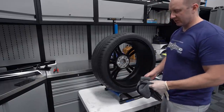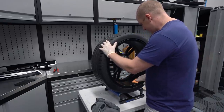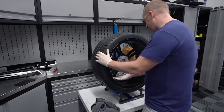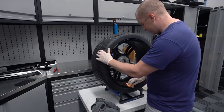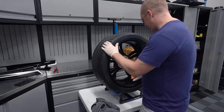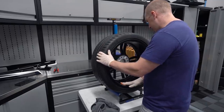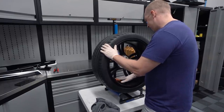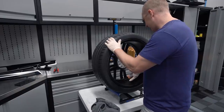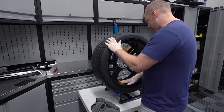CSL is not layerable so we're just doing a single coat. I'm just using one of these little Car Pro suede towels that I've been cutting up just to get rid of them. That was back when I bought a case of suede towels - back when you needed that to level some of the original coatings. You would follow the application with a suede towel then use a plush towel to finish off wiping off the residue. You just don't really need that anymore, so I've been cutting them and using one piece at a time for application on the wheels instead of the more expensive pre-cut ones.